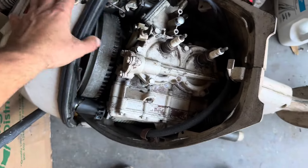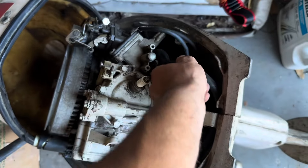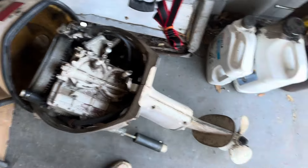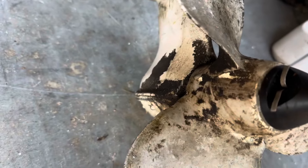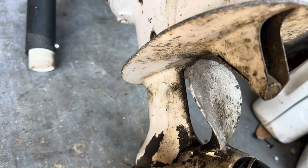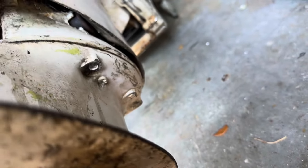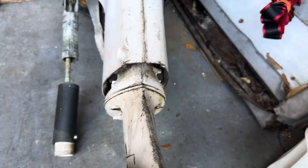When I bought it, I got it super cheap knowing that it didn't have a fuel pump on it. No fuel pump — okay, not a big deal. But this is a big deal: the lower is leaking bad, and this is after I wiped it up. This was all built up. I just cleaned it off so that way I could handle it in and out of my truck. And then as you guys can see, one, two, three, and four lower unit bolts have been broken off in the upper half.